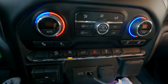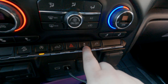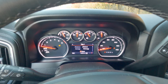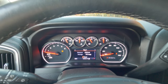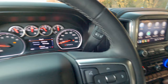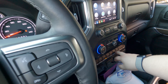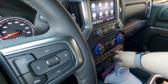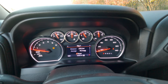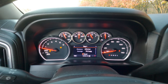If you go down, you will see a traction button. Now, if you click it once, your traction control does go off. But the system is much deeper than this. So if we go back to our traction button and we press it — okay, that turned it back on. Now if we press it and we hold it, watch what happens. Boom. Electronic stability control is now off.